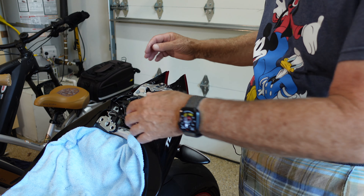With the more exposed license plate position, you reuse your stock turn signals, and they provide the hardware to bolt those in. The standard turn signals come with small plastic spacers to bring them out, but these don't fit on the Moto Dynamics tail tidy. I don't think they're necessary - it gives a nice compact look and they're bright enough anyway. So I did that pre-assembly before we go back and put it on the bike. The last disassembly step is to remove the overall holding plate from the bottom of the machine. We won't be using the upper screw; it screws into a pre-threaded aluminum forging, so we remove that.